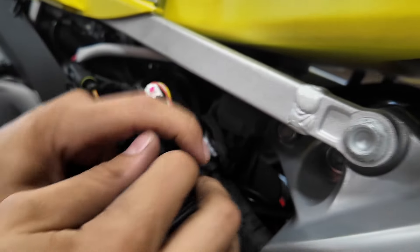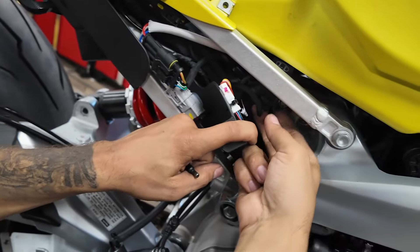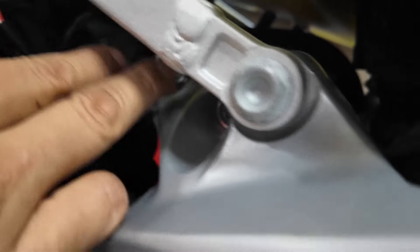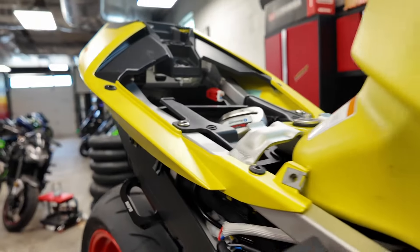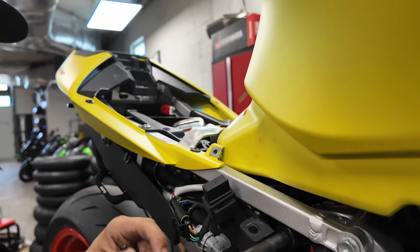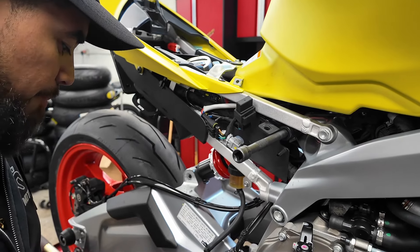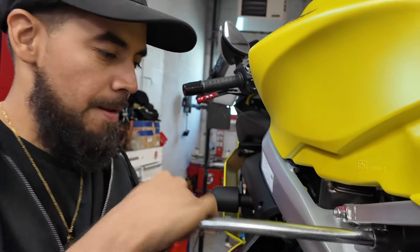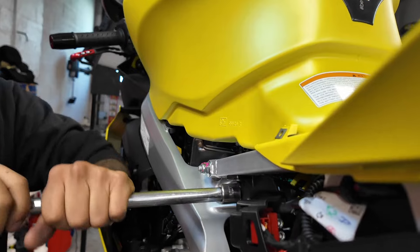That pops out — it's like a rubber relay or sensor. I've got Brian here behind the camera, so you're going to want an extra set of hands for this portion. He's going to hold one side with a ratchet while I go to the other side with a bigger ratchet to loosen up the top of the shock. Once you loosen it up it should come out fairly easily, because remember we are supporting the whole engine from underneath at the exhaust.